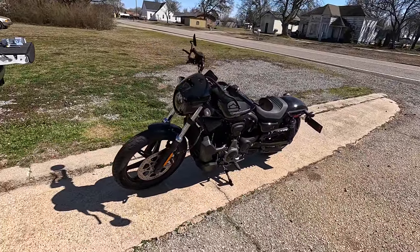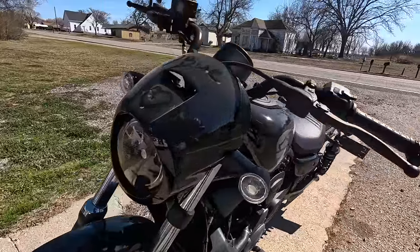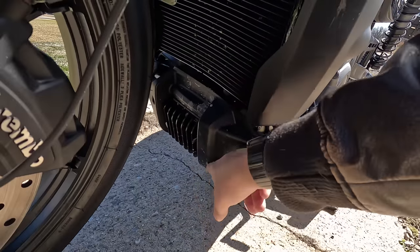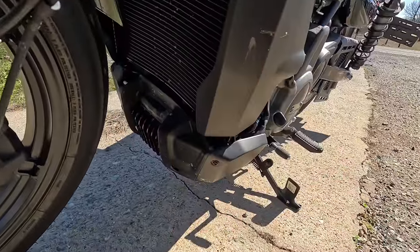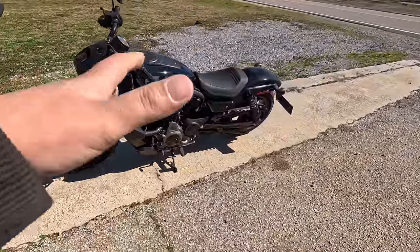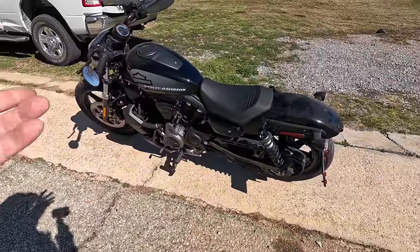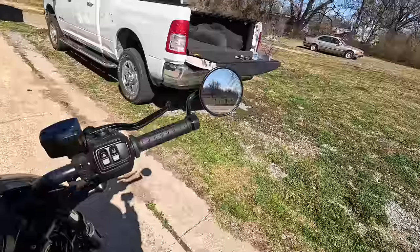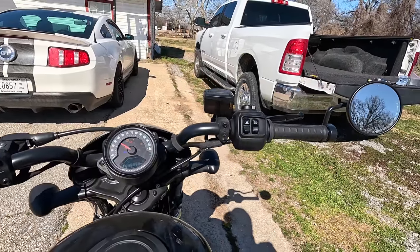I didn't film it because it was kind of boring, but I took the cover off the battery. I found out the battery sits down there — you don't have to take the side covers off, just one bolt there, two on the other side, this whole cover comes off and your battery is located right down there. I put it on a regen cycle and it charged right up. Now she should start first try.